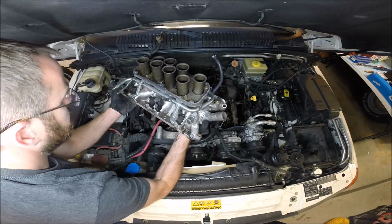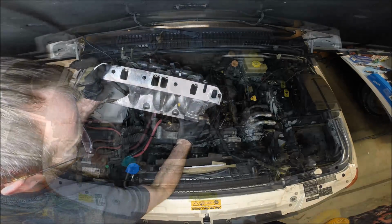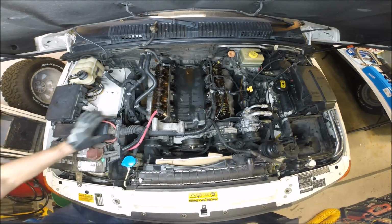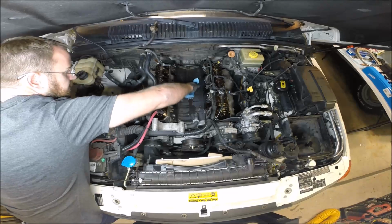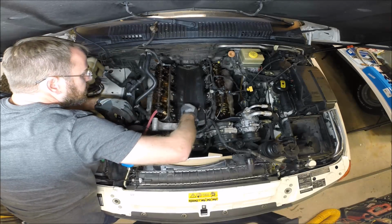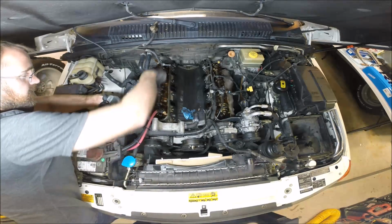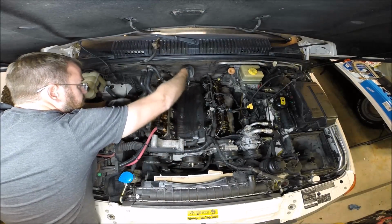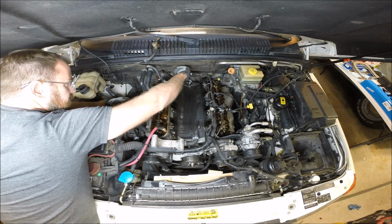There we go. One GEMS motor manifold. Pretty clean. Alright, so we've made pretty good progress. We're going to get this intake valley gasket off, and we're going to be really close. Moving forward here on the exhaust manifolds, and then the rocker arm assemblies will come out, and then the heads will come off. Everything's just 13mm. 13mm sockets, 13mm wrenches on everything here.